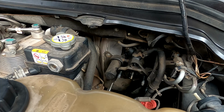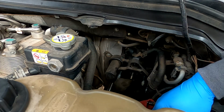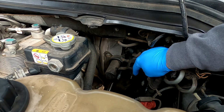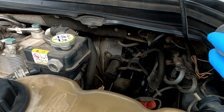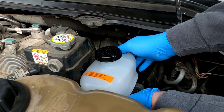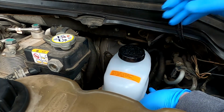So the other one's out, and compared to other jobs that I do, that was really fast. So the video would have kept going, but my battery died. So we'll go back in with this one. There's nothing you need to do. Just make sure that this little plunger right here goes in the hole in the end of the master cylinder, which if you miss the hole on this, I honestly don't know what to tell you. It's pretty easy to hit. Just like that.